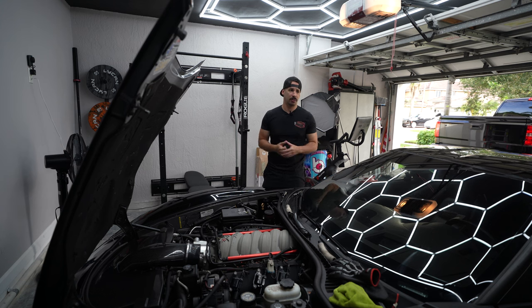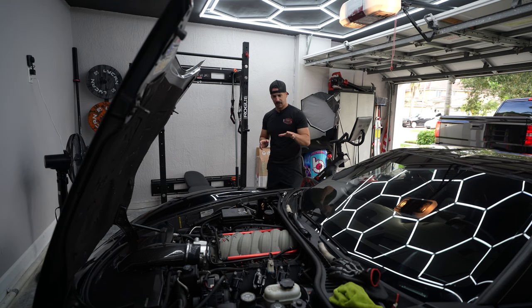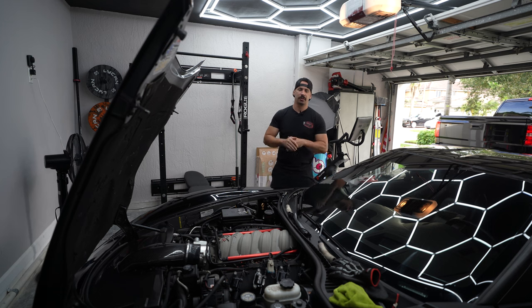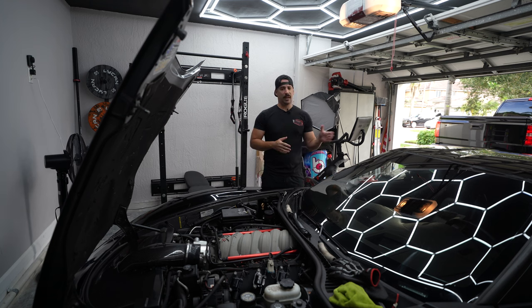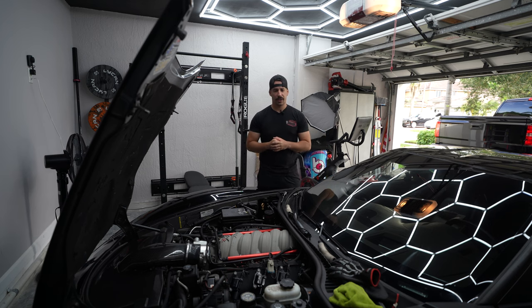Obviously that's not normal, that's not okay. I went ahead and replaced the battery because it left me stranded the other day. Put the new battery in, got a false positive on a crank position sensor. I cleared the code and the car's been running fine since then. Fast forward to this week — I've been out of town, I come back and say, well, I'm about a week into this, let me just take it around the block, see how it's running, see how it's starting. I've had it on the tender for about a week and a half.